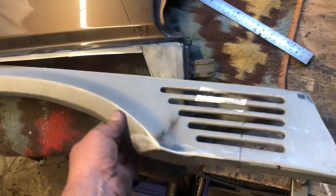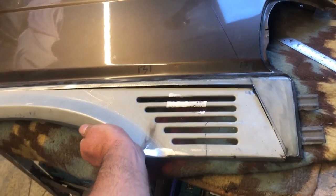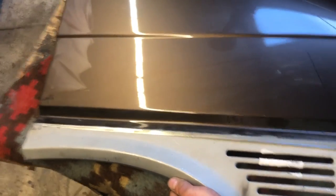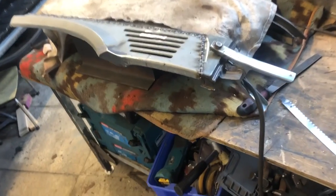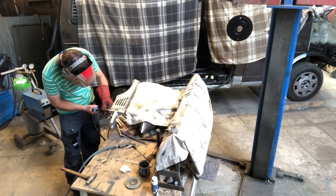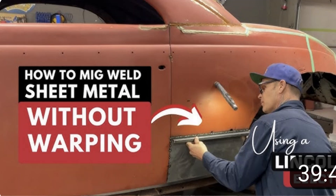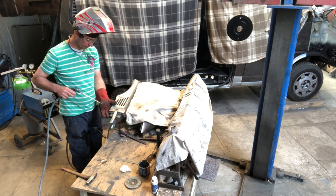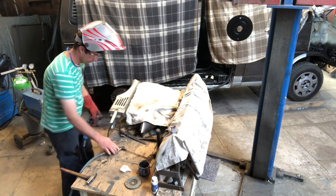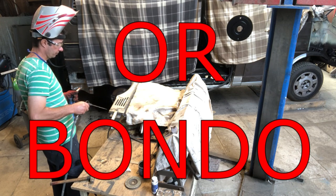With the bottom lip moved up 20mm, just a bit of a test fit — and there we go. Now start stitching in position, getting it perfectly level between the two panels the whole way along. I wanted the stitches about 13mm or half an inch apart. Then I welded four stitch welds at a time, blown off with air to cool it down, then four more stitches and blow off with air. That's the theory from the YouTube channel Bad Chad — it keeps the panel cooler and stops the warping, or at least reduces it, so it requires less filler.